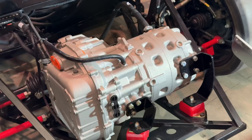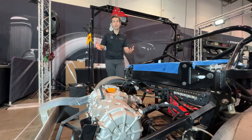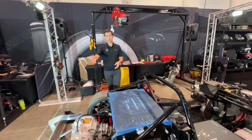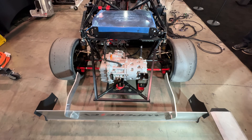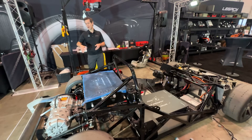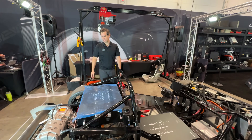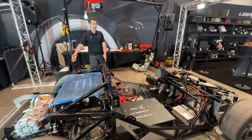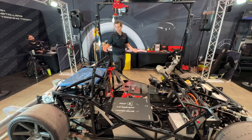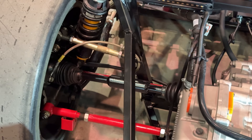In this one we've got a Maverick 25 motor, which is newer to the market. It's a bit like a Tesla small drive unit, but instead of pulling one out of a wrecked vehicle — where it gets bench tested but there's no warranty — this has a one-year warranty and is a brand new unit. It actually puts out a little more power than a Tesla small drive: around 300 horsepower peak and 305 pound-feet of torque. We're just under 2,000 pounds in this chassis with that much power, so when you go around the track you have a fun time.